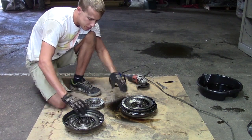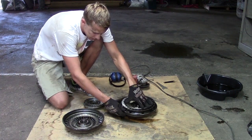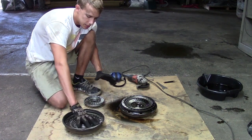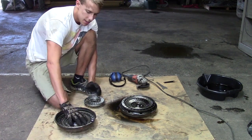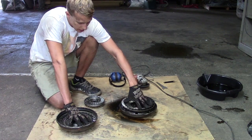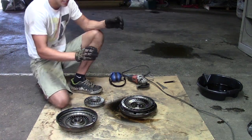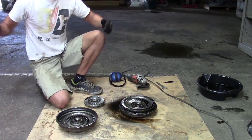The pump just pumps fluid and there's a little bit of friction, but your brakes have stronger friction so it won't move the car. On race cars with automatic transmissions they have high-stall torque converters, usually much smaller in diameter. You have to get the engine up to a certain RPM before the turbine will engage and drive the transmission. That's why you see guys hold the brakes, hit the gas, see the rear end jack up as they preload the torque, and as soon as they release the brakes it just takes off.